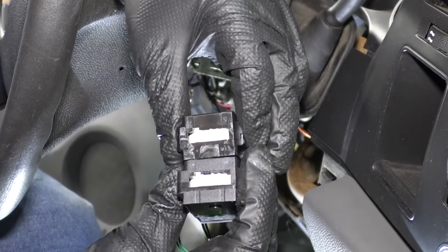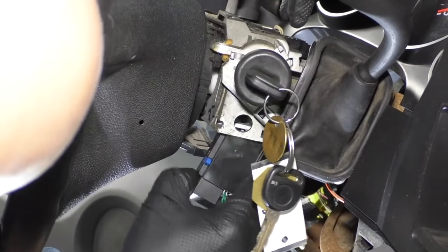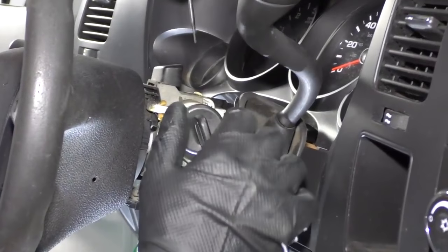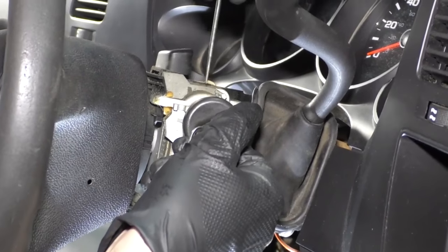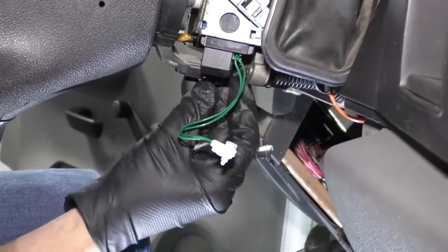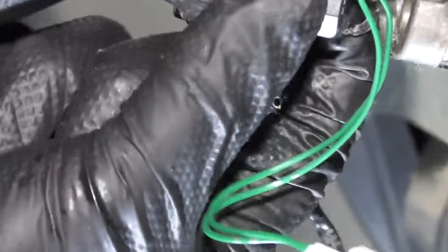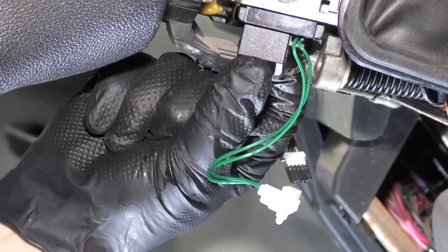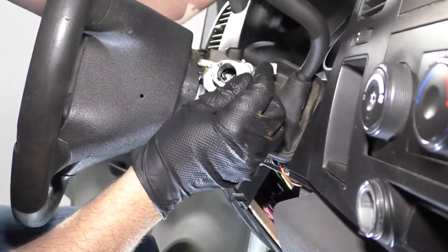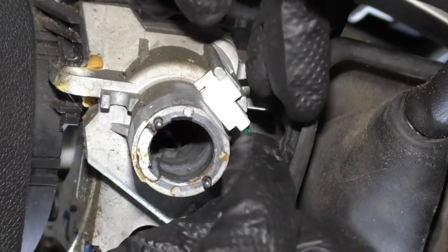Make sure it's lined up — that's good. Take the new one and install it, slide it into position, and lock it in place. At this point I can take the ignition cylinder out again, rotate it to the start position, push my pick in, and remove the cylinder. Now we're going to plug the ignition switch in — just take the connector, line it up, push it on. You're going to want to lock it in place and then push down on that red lock tab. Then take this wire, slide it in, and there's a little hole up top — just twist it and it locks in place.